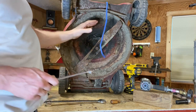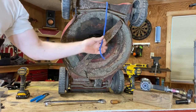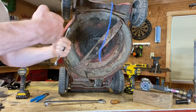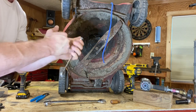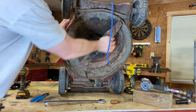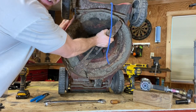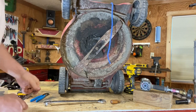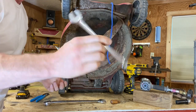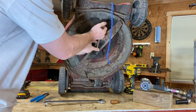All right. We've got the lawnmower tilted up back underneath. This is the rope. It's inside the motor. And when it's done, it's cinched up in that motor. It allows that piston to be stuck. Thus, this bolt is stuck. This whole crankshaft is not moving. That way we can crank on it now and give her some power. Your first step, of course, you're going to take your 9/16 wrench and see if you can get that sucker off.